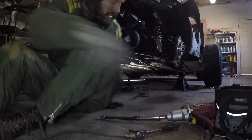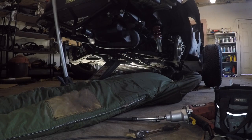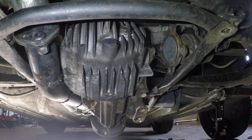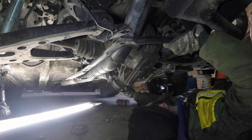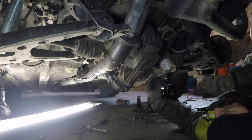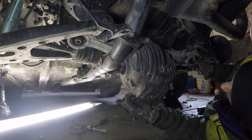Half shaft out. Now I just got to make sure that it's actually free of the power plant frame. Even though there is a way - some kind of magical Tetris twisting maneuver to get this thing to fall out - you can always just take these 17 millimeter bolts out of this frame here and drop this frame, and then the entire diff will fall right out. With that frame out of the way, there's really nothing holding this in. We can move the axles out of the way to drop this over and then lower it right on down.